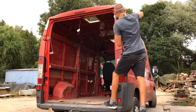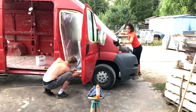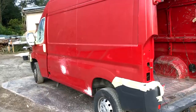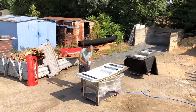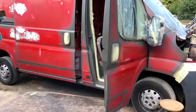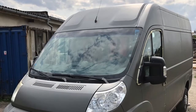For sealing you need some good glue that is resilient towards weather conditions. This next step is skippable for most people — it's a paint job. First I did some body filler to fix imperfections. Second, I ran around the car with fine sandpaper and sanded down loose paint and rust. Third, I washed and degreased the entire surface. I decided to just roll the paint on our van — it's the cheapest and fastest possible way. I spray painted all curves first so you don't see brush strokes, meaning doors from inside, the roof, and all curves around the van. After this I do two coats. The result is pretty good. I don't stress about scratching the car at all — if I do, I can anytime do another coat for a few dollars.